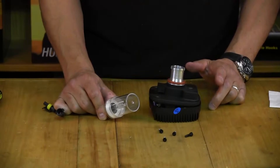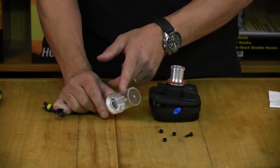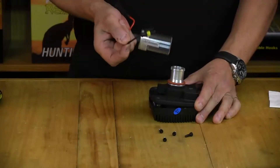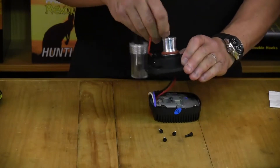When you fit your replacement bulb, be sure to keep the bulb in its protective housing. You don't want to touch the HID bulb. Simply feed each lead and terminal back through the hole where the bulb seats.